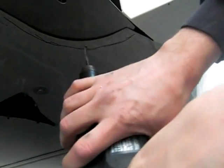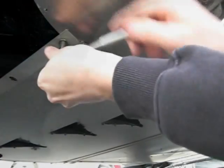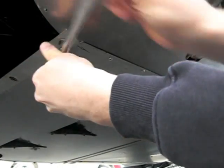You'll want to be extra careful when you're drilling towards the front of the Aero Plates because of the rubber hoses. Finish tightening up the nuts and bolts to the under tray. Once it's completely secured, you can fasten those 2 nuts back onto the diffuser and under tray that we took off earlier.